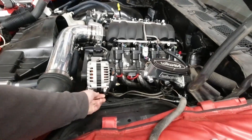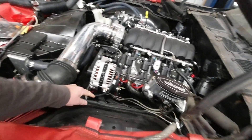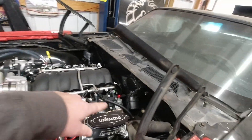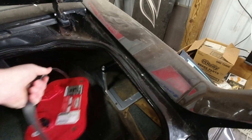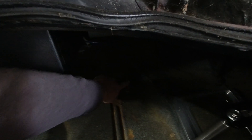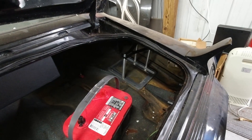We're also going to run a ground from the side of the alternator somewhere. I'm not exactly sure where I'm going to ground that yet - probably just going to ground it to the inner fender well right here or something. I've got a few other grounds I've got to attach on the wiring harness to the back of the block, and I've got to make a ground for the battery. We've got a new Optima battery - I think it's going to land right there in the trunk. My hot will go there and then a ground will probably just be hidden back in the corner somewhere.